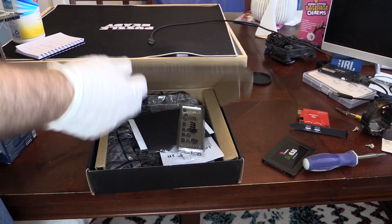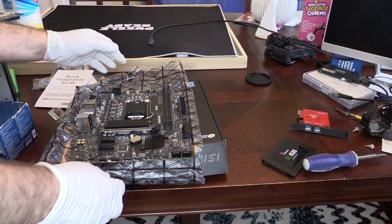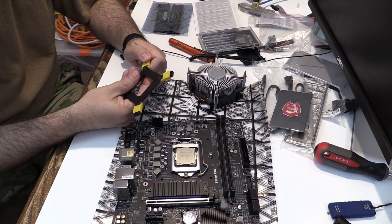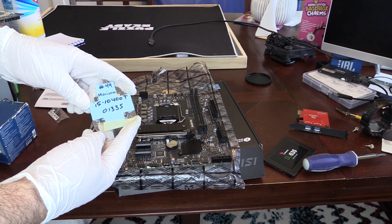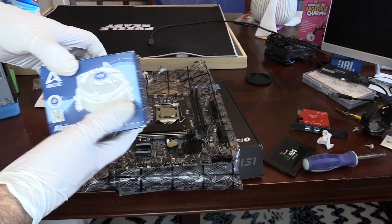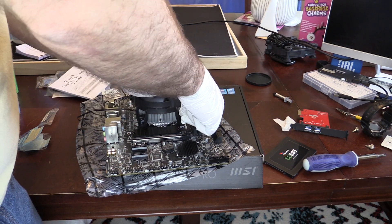The motherboard replacement is an MSI B560M Pro — a renewed board with all the accessories. I tested it while in Alaska and used it in my video on how to use Wake-on-LAN in Linux from an MSI board. Initially I was going to use a Pentium G6400T I picked up for $35, but instead I am using an i5-10400T which I also picked up and used. Cooling it will be an Arctic Alpine 12 CO which can run pretty quietly. The push-turn retention tabs gave me some grief, but nothing I couldn't overcome.